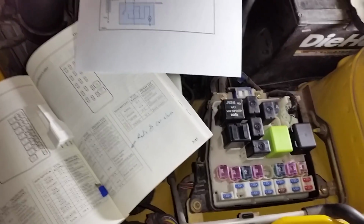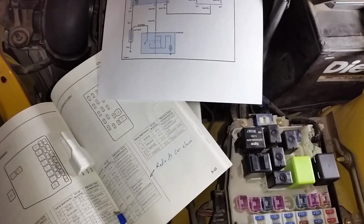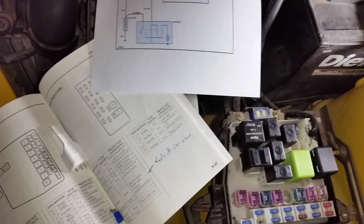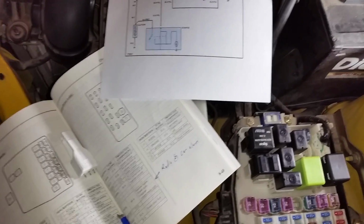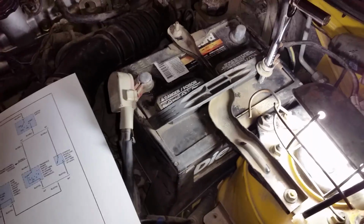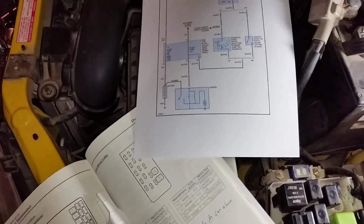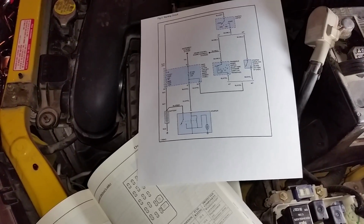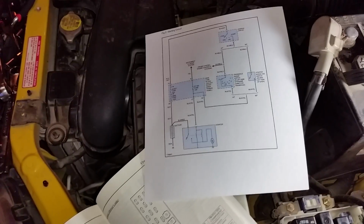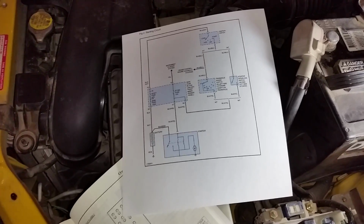I'm 2 or 3 days into this project, so we'll do a rundown so you can save time and money, unlike I did. A couple days ago, my Mazda Protege 5 did not start. It did not crank over. I have a reasonably new battery, so I could hear clicking inside my car. And I figured the clicking was a relay that controlled the starting circuit. That was incorrect, but we'll talk about that in a minute. Long story short, I figured I had a bad starter.